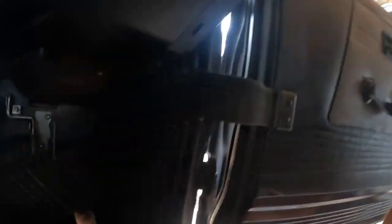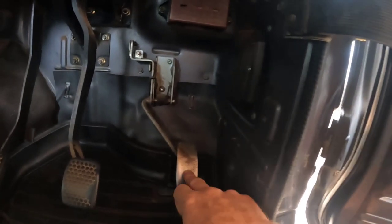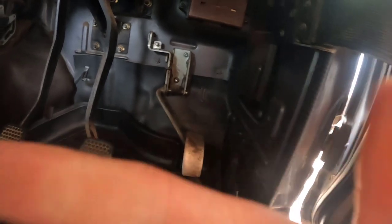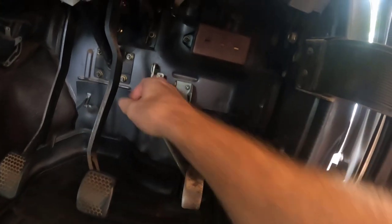Let's have a look at the throttle cable — I wanted to replace it because this pedal is super sticky. If I press on it, you can see that's how far it goes, but it's not even pulling on the carburetor at all. If you want to depress it all the way to the floor, you really have to flex your foot muscles. I spoke to a friendly guy that specializes in Suzukis, and he said it's probably just a dirty cable — if it hasn't snapped, don't replace it. So we're going to clean it out with WD-40, lube it again, and hopefully it's going to drive better.